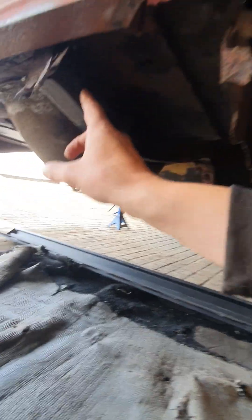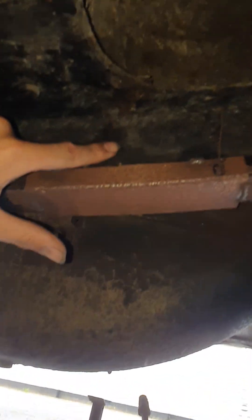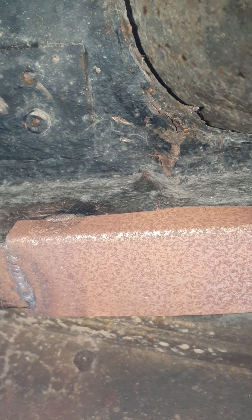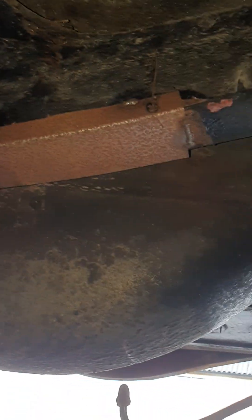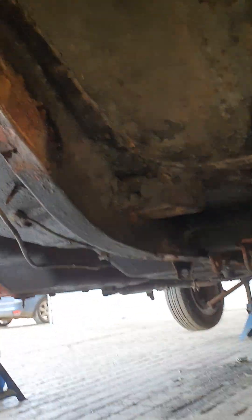I also need to pull this chassis leg down. As you can see if you look here, the leg has been pushed up — it's pushing together like a mountain coming out of the ground, pushing in and then pushing the material out. So I've got to pull this down a little bit. There are a few repairs in here and I need to do all this chassis work in here.